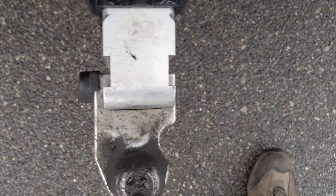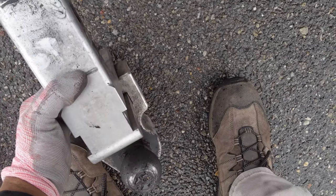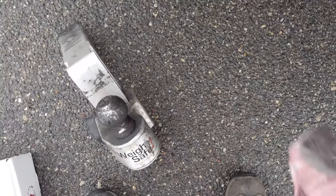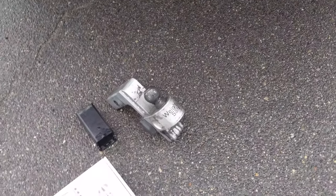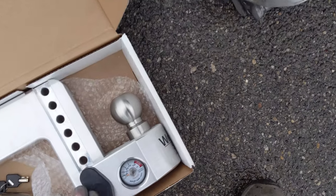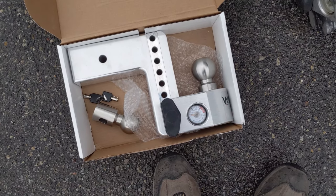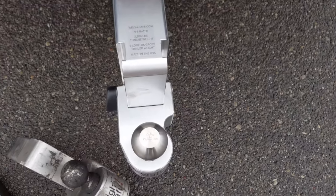First, to switch this thing out real quick — slide this out, hold the winch shank right there. This hitch has been good over the last two years, it's still measuring the weight and everything, but with the 450 I wanted to go ahead and order the three-inch one. This new one's crispy, guys — crispy. This guy's going on the truck. It does not need a reducer; the difference is it handles more tongue weight and more towing than the two-inch shank. Look at that beauty.